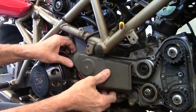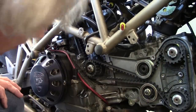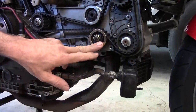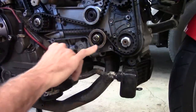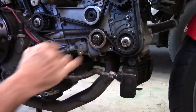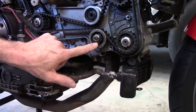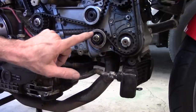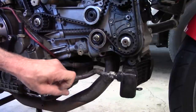There's a little notch in this cover that lines up perfectly with the oil pressure sending unit, and then the cover comes off. So here's the deal: this is the tensioner and it rotates to tension the belt — it rotates counterclockwise. There's an offset to it. This is a 22 millimeter nut size right here, and the lock nut holds it in place. You need to put a 22 millimeter wrench on here as you loosen this up, or there's the possibility that you can loosen the whole stud from the case.